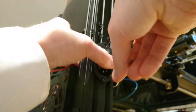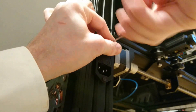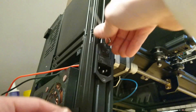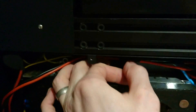Then we put it back together. When you're screwing the bolts, don't do them both really tight straight away. Do them mostly tight each way, and only then tighten them, because you don't want to tighten one all the way and then find you can't get the other one in because you've forced it to be a funny angle. They don't need to be really, really tight — check it's solid. Then check the wires aren't caught on anything. The main wires would normally go over the power supply like this and be taped here. Mine I'm routing them around because my power supply has a bigger fan on it and it sticks out more.